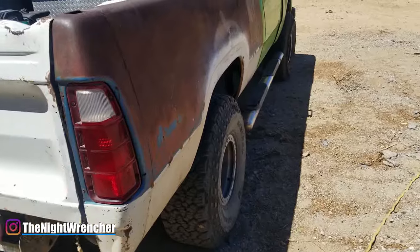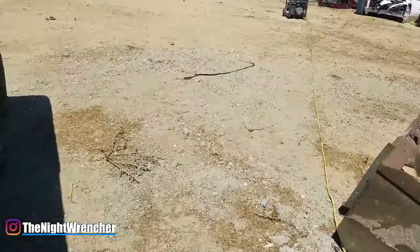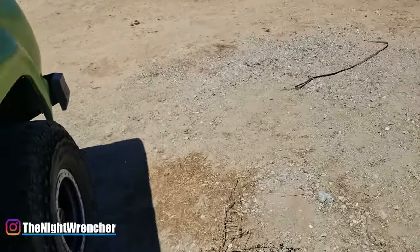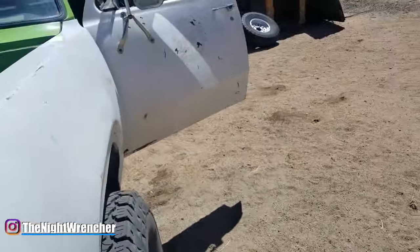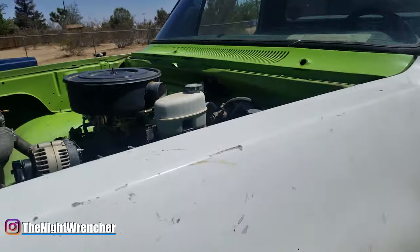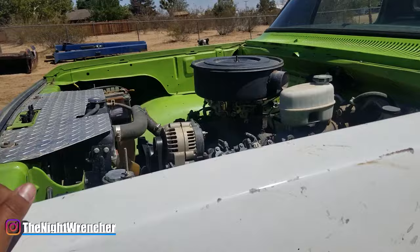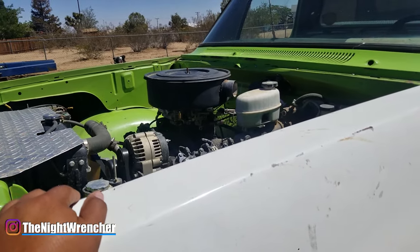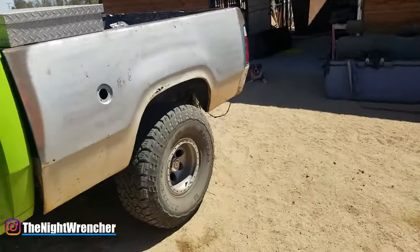And we're all good to go. While I'm allowing my engine to warm up, you guys can kind of hear it's got a pretty consistent idle. When an engine is started for the first time when it's cold, the engine tends to run a little off, whether that's rich or lean. It can be either one, and it just depends on the intake manifold design and the type of head and compression. As it warms up, it'll start completely burning up all the fuel that enters it and stabilize. After the engine's up to operating temperature, that's when you can actually do a little bit of tuning.